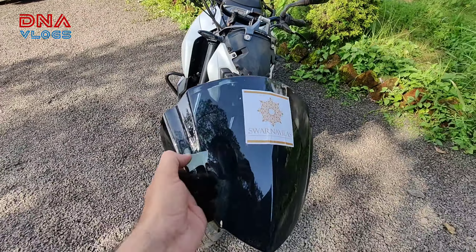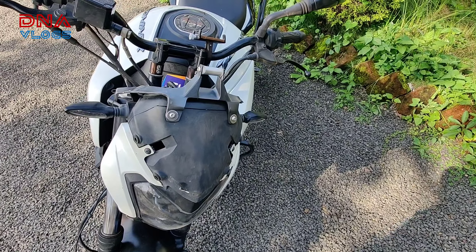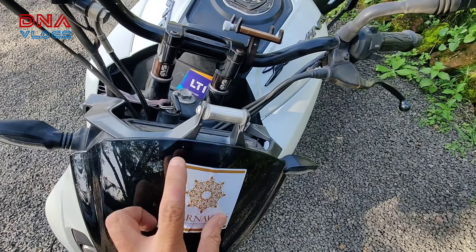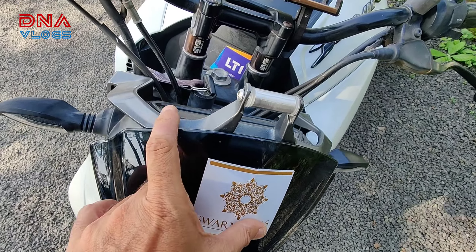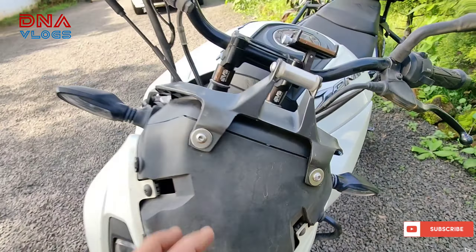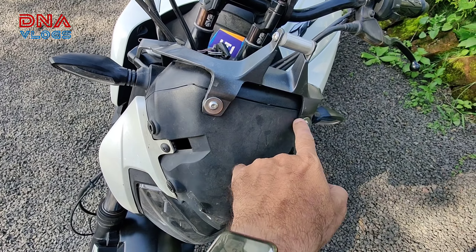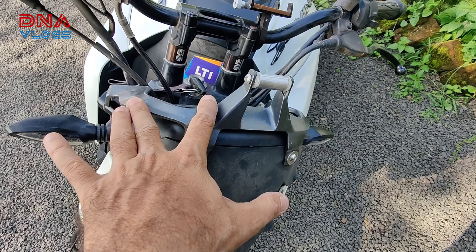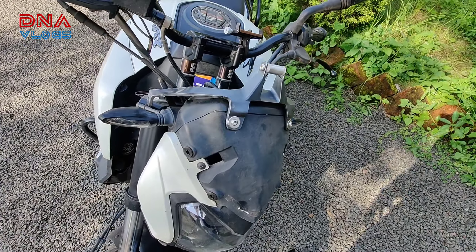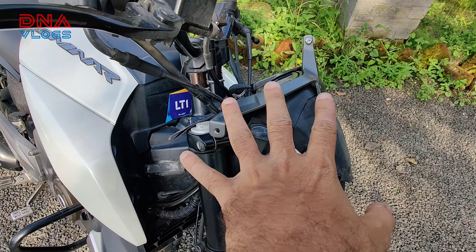So if you have a stock visor on the 2017 or 2018 Dominar, this is a very quick and easy fix. I'm not fixing the visor completely, but your visor and your number plate can easily fit here. It is slightly touching the GPS mount — you can insert two-way tape here so that the visor doesn't rattle. I took off the two stock bolts and replaced them with two one-inch long bolts with a washer and put the GPS mount on. This is a temporary fix because I forgot the center part — it's at SK Auto Care.